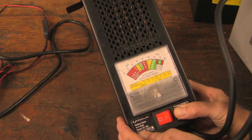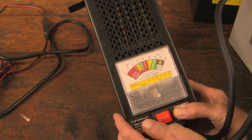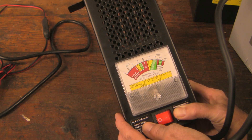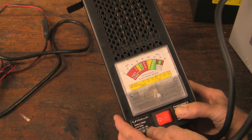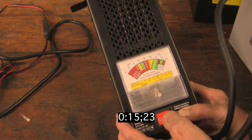I've fully charged the battery in the garage for a few days. I took it off the charger last night to see if it would hold a charge overnight — it's been about 18 hours — and the resting voltage without the tester on is about 12.7 volts. Let's see what happens when we put it under a test now. We'll go for 15 seconds.